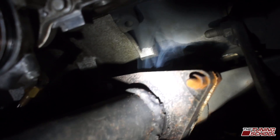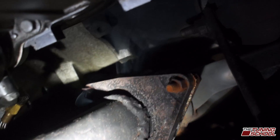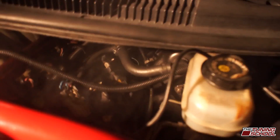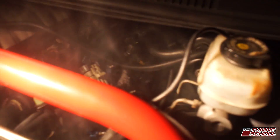As you can see from this clip, this is us smoking the exhaust system on our Trans Am. You want to do this if you think there might be a leak around the exhaust flange where the headers connect to the exhaust system, or an exhaust manifold gasket leak, or anything like that. Typically, the good place to do it is pull an O2 sensor — or like a secondary O2 sensor — and put the smoke source into it, then wrap it in a bunch of electrical tape to kind of seal it up real good. Then you have to cap the tailpipes. So now the smoke is all encapsulated inside of it and it'll help you find your leak.